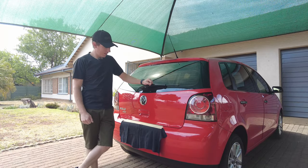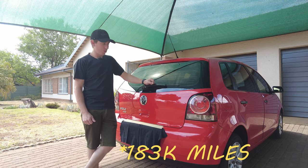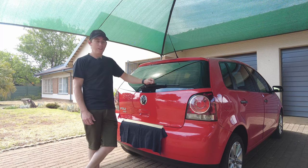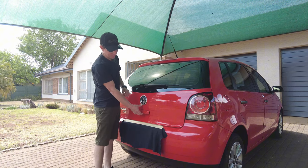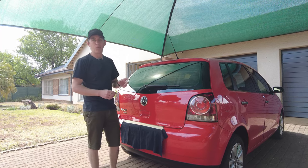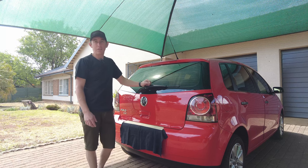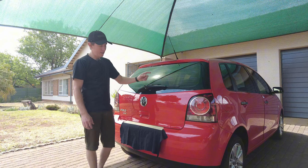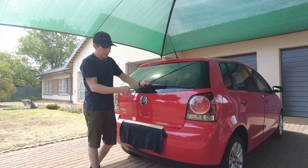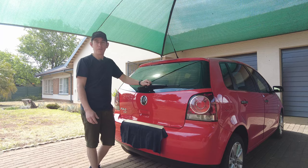Hello and welcome back to the channel. Today I'm going to be working on my car — I call it Old Faithful. I've had it now 11 years, it's got almost 300,000 k's on the clock and it's been having a little bit of issues here and there. An issue I've picked up lately is it doesn't want to open the boot. There are two components in the boot: a micro switch behind the handle and an actuator. It's a common fault on VW cars that the actuator stops working. I've already bought one — we're going to strip it, test the micro switch, check the actuator, swap the actuator out and hopefully get it sorted.